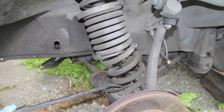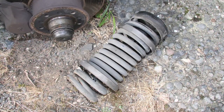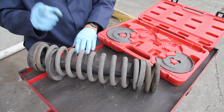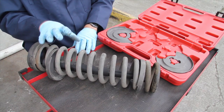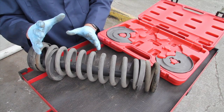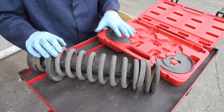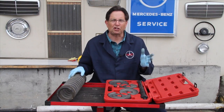You've got to bring the spring down tight so you can actually get it out and on the ground. Once you get it on the ground, you still need to be careful backing that center rod out to free the two plates. I always treat this spring like a poisonous snake, and I think you should too. There have been times I've even tied it off with a rope when nervous about it popping out by accident. If you don't feel comfortable doing this job, once again I recommend taking it to a good front suspension shop. You may have already seen this compressor for sale but weren't sure how it works.